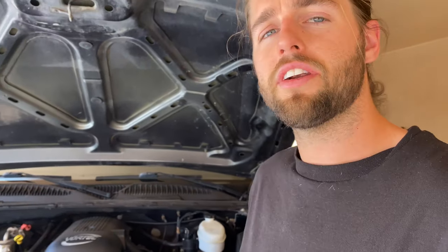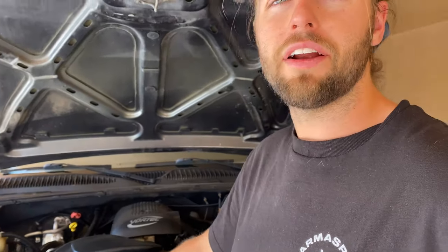From here we'll dive into the process of this air conditioning. We're going to be changing out the condenser, which is this guy right here in the front - I removed the grill already. We're also going to be changing the orifice tube. This truck was overcharged when we got it - it was working, it was blowing cold air, until you got to a stop sign, stop light, or drive-through, then it stopped blowing cold air and got warm.